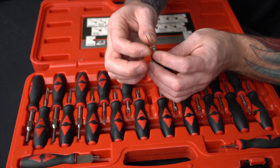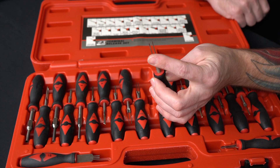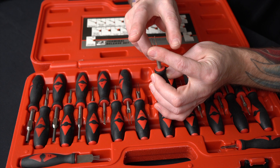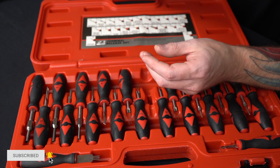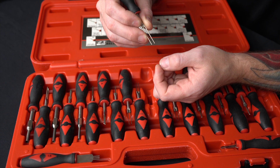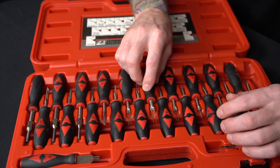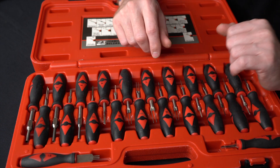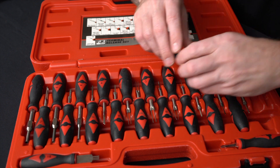You'll see it has two little arms. A lot of terminals — especially for European, German stuff, and late-model GM — will have two holes, top and bottom, by the pin. You'll see this on large junction connectors on Tahoes and similar vehicles. The tool slides down into the connector, pushing the releases that are built into the terminals both down so you can pull it out. The reason there are so many different tools is that each connector has slightly different tolerances — bigger pins, smaller pins — and even the same pin in a different connector may need a slightly different size tool.